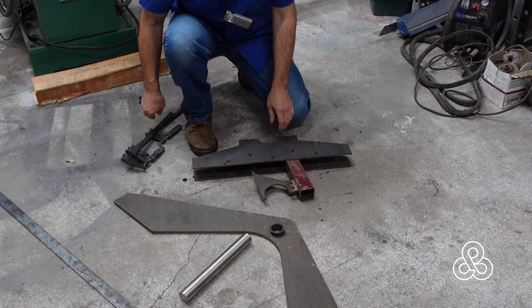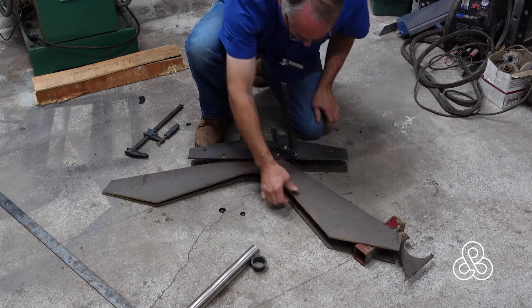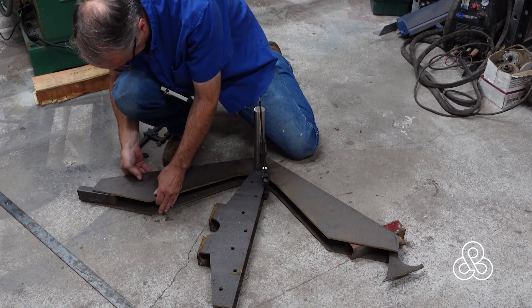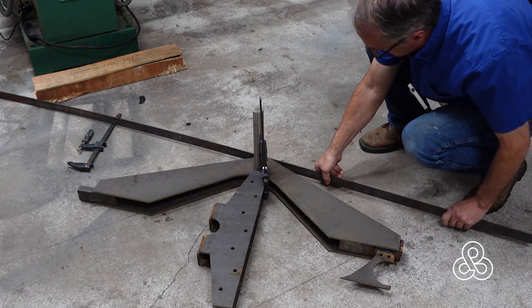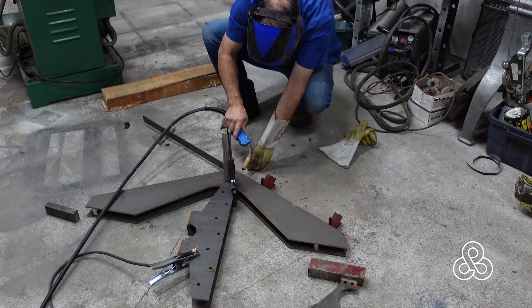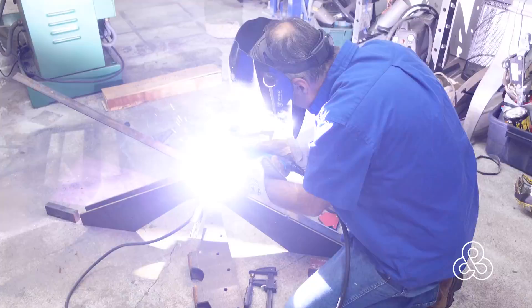We'll get these all welded up. Now that it's welded we know that the gap in there is two inches. I'm going to show you these two pieces — they're actually going to be in another video. They're the part that will be bolting to the chassis as the second part of the three-point system. We'll use the brackets we just built to space them out right; they are two inches on the outside. We throw our stainless steel pin in to line it up in the center, then connect these two plates together with a flat bar — tack weld that flat bar in place and wrap it around the radius bend.